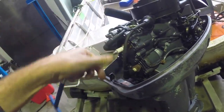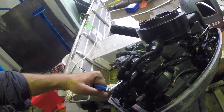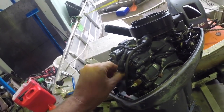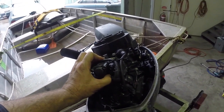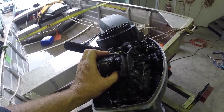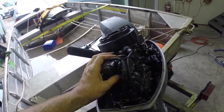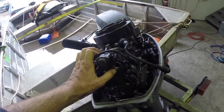New step one. Now we know what's going on with this motor, I'll take these rusty-looking spark plugs out. This motor lives on the water and doesn't get used a lot, which is a bit of a prime candidate for seizing problems. So what I'm going to do is put something down here to lubricate the pistons, because it's probably the rings that are a bit stuck - and we don't want to snap those rings. There are a few different things you can put in here. In the other saving-a-sunk-outboard video I used automatic transmission fluid, which is very fine and good for soaking in with a bit of capillary action. I've also recently got some bolt buster stuff for unsticking seized bolts, which I'm almost tempted to try. So I'll give it a go and we'll see what happens.